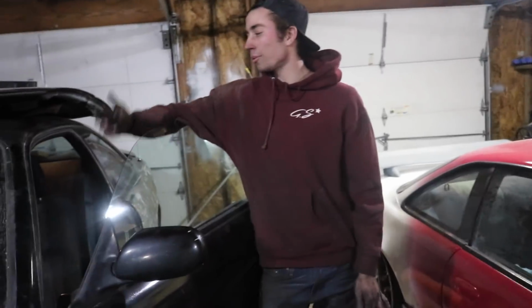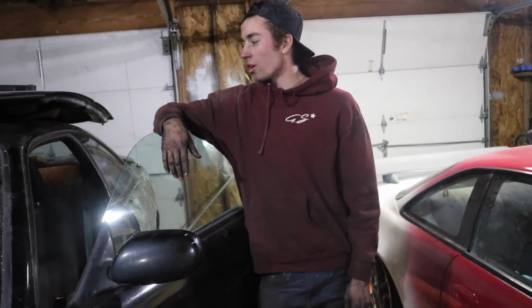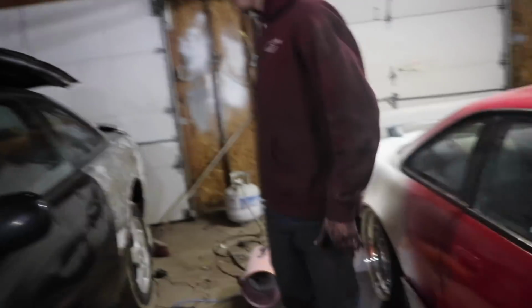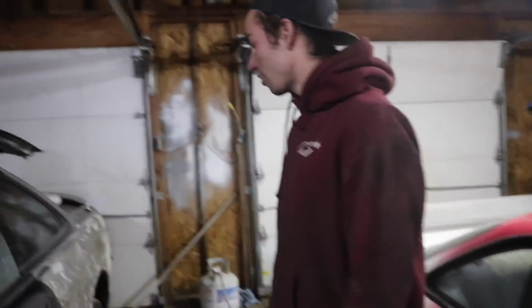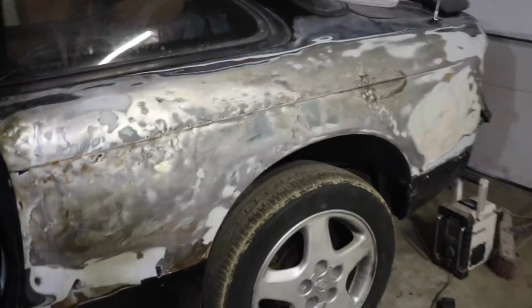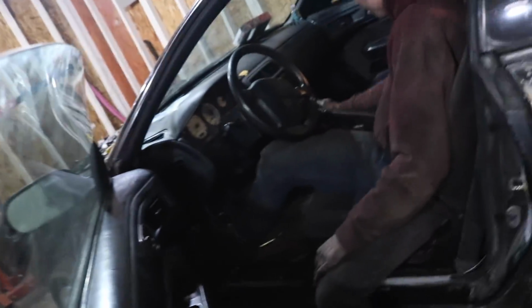And sadly, we don't have the slave cylinder, like I said. So just to make sure everything's okay with the clutch, I'm gonna start it up in gear. There is no pressure on it, so the wheels are just gonna free spin. But it's just to make sure that the clutch is in there and the throwout bearing isn't dangling around or something stupid. We've already started the car, so we know it runs. But here's our shifter, our 5-speed now, dude. Our 5-speed.